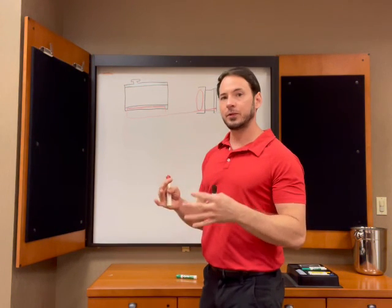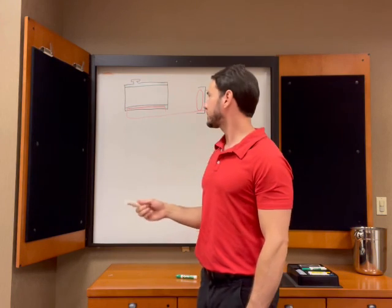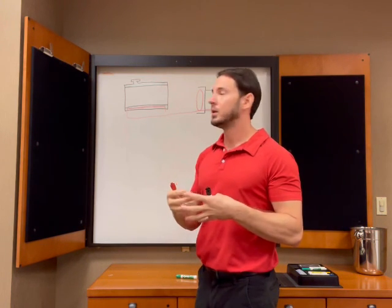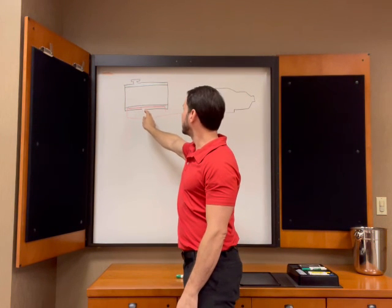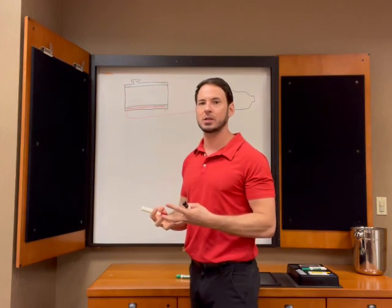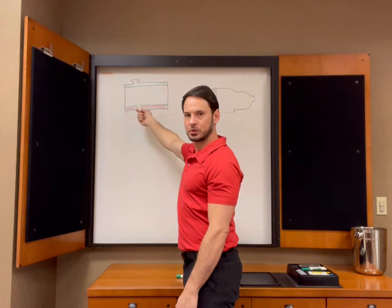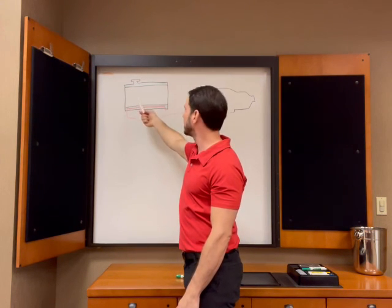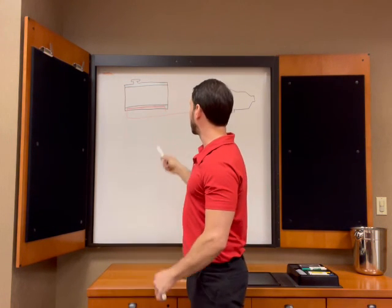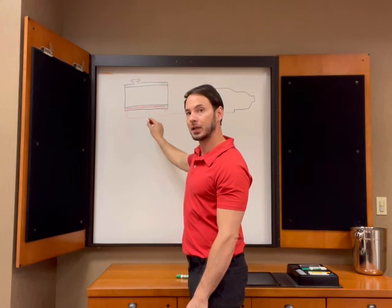Well, remember, we've got two fluids where one of their primary jobs is to transfer heat, and we've got a piece of metal here, which is a very good heat conductor. So in that way, these two fluids are gonna very quickly try to reach equilibrium. If the ATF is the hotter fluid, its heat is gonna be transferred into the engine coolant. Now notice I did not say directly to the air, because remember this pipe in here is just in the lower tank of the radiator, so it's got coolant all around it. That hot ATF in there is gonna make that copper pipe 230 degrees or however hot, and the coolant will then take that heat off and transfer that heat to the air. Now, of course, again, just for clarity, there's no direct path from the ATF to the air. Okay, so we've transferred the heat from one fluid body to another fluid body.